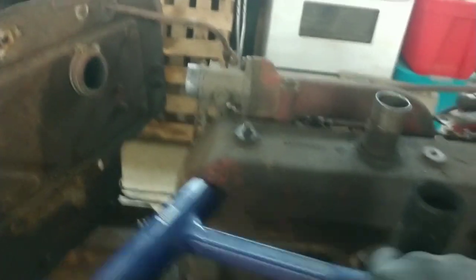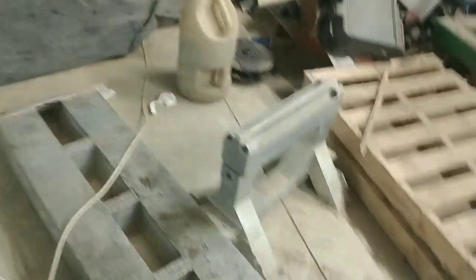This is a slim 32-ounce hammer — actually a piston installing dead blow hammer from Summit Racing. It was on the bench because I was doing the 706. I would not dare use the long side, that's the piston side — we're going to use the short side. Give her some knocks. You hear it getting hollow? I see it bouncing now. We're wiggling. Looks like our gasket's staying. Thank goodness — talk about a heavy valve cover, it's cast iron.